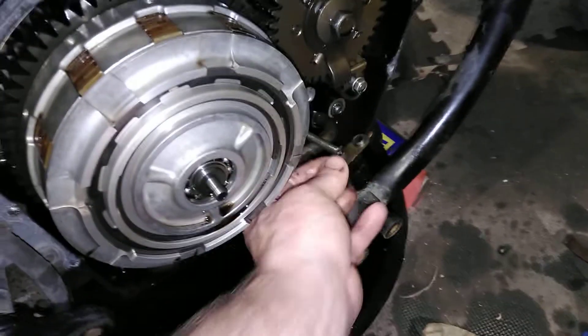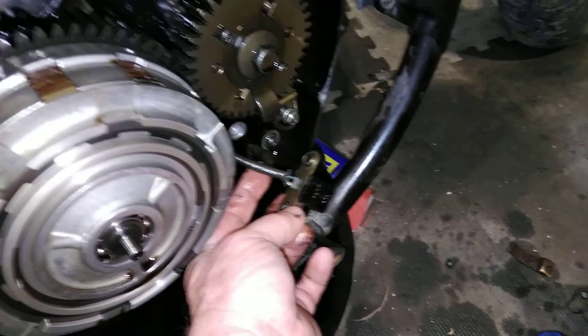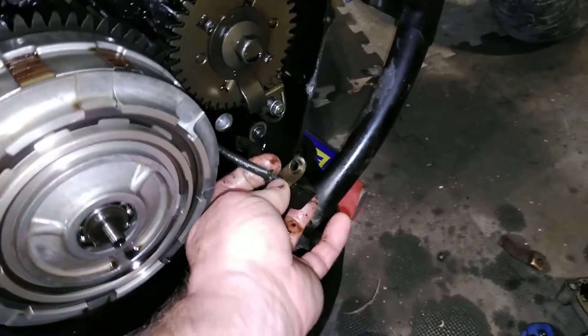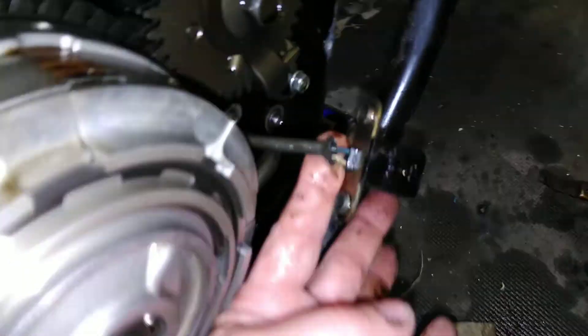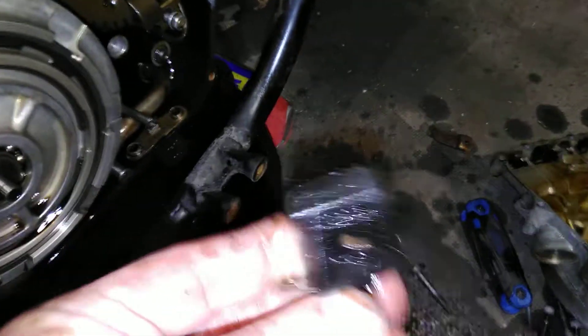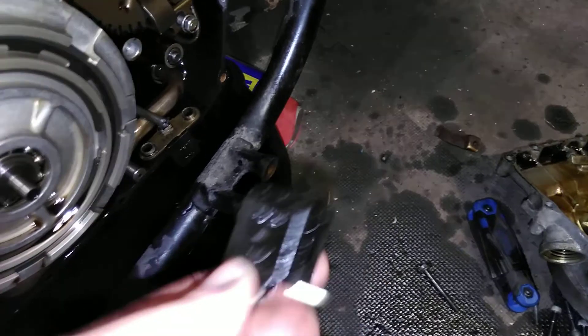I can put the new pulsar in there and splice into the wiring — I'll probably pull this sleeve back and cut it back, splice it together, put it back in, and check the gap to make sure everything's okay. I did have pulsars off of a VF 750 — that would be the Magna body style — and those would work just fine, but the problem is mounting it.